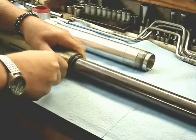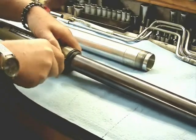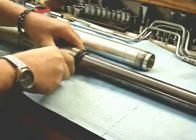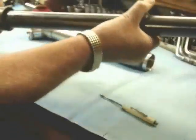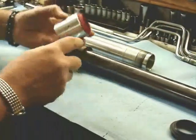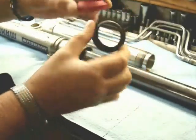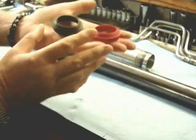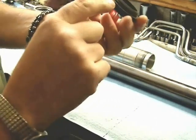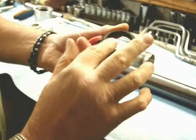Using a small screwdriver, you can work your way around the top and get loose the fork dust seal wiper. I have in my hand here the wiper, not the seal — the seal is on down inside there. There's another variation of the wipers used in model year 1995. They're rare; you'll see them in green and red, but mostly you'll see the black rubber one with a spring around the perimeter. It's actually better than those hard plastic ones.